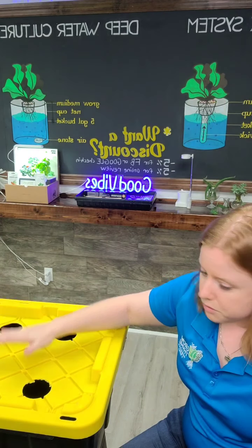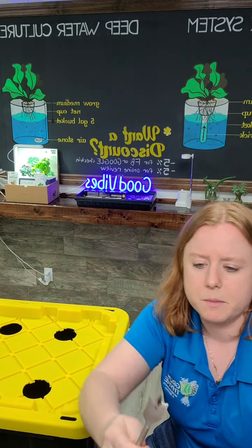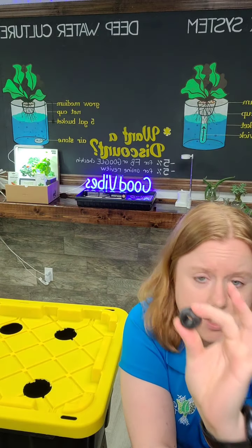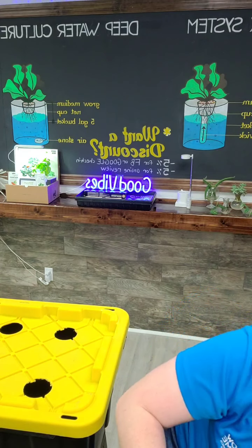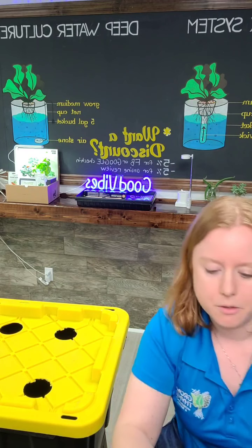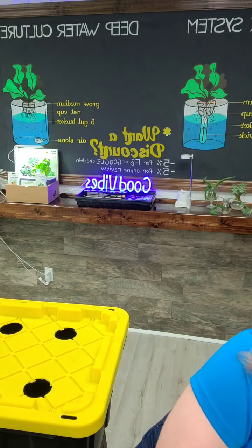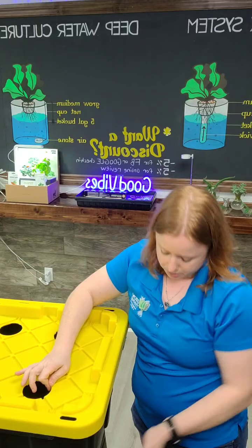But once you drill your holes using your hole saw, you'll also want to make sure that you're putting a drain plug in. Remember, we use the 7/8 drill bit, and that's what makes way for our rubber grommet. I use a 1/2-inch rubber grommet and a 1/2-inch barbed plug. And just to show you how affordable they are, we actually sell both of those in our store for 32 cents and 42 cents. So you can put that drain in for under $1. That's pretty easy.